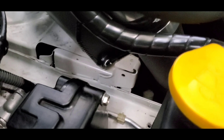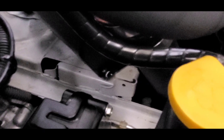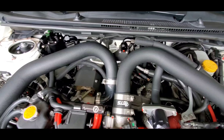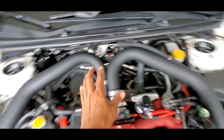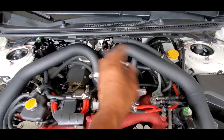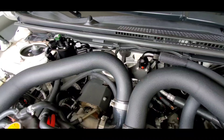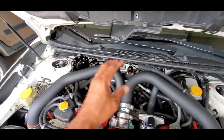To drain this breather tank there's a 1/8 NPT drain port right there. I can always add a valve to make things easier. The reason I split it apart from the main AOS is because the cylinder head side will be cooler than the crankcase side. When you have a temperature differential you get condensation. The cold/clean side stays separate from the dirty crankcase side — that's why you get milk inside your AOS and need heaters to combat it.